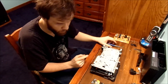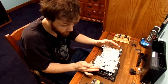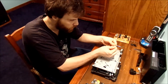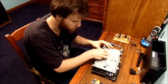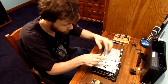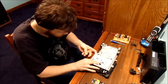Once we've got all these smaller screws out, if you want, you can use a magnet to pop the screws out as well. But do yourself a favor — don't mix up any of your screws with machine screws. Just be very careful with that. This magnet is a very weak magnet — this is not going to destroy anything on the system. I'm just showing you how to disassemble the PS2 console. But be very gentle doing it this way, because you've got some sensitive connectors. You don't want to go yanking wires out.